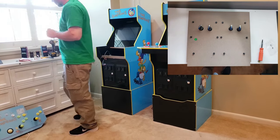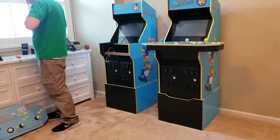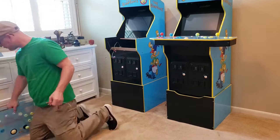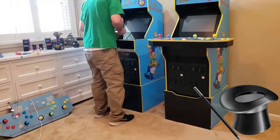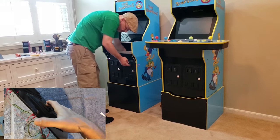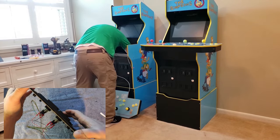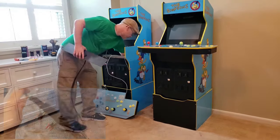When I add the screws and plastic caps back on at first, I only add two of them and I don't screw them down all the way, as I'll be needing the coin door with the button mounted behind it to have some play that will let me make adjustments. The ability to make adjustments is very helpful — without that, I'd not be able to get the coin door insert and the button mounted behind it aligned correctly. It takes a minute to get the button and the coin door insert aligned, but once the two are in the right spot, arcade modification magic happens — or rather, when we press the coin insert, the button mounted behind it also gets triggered. Once aligned and in working order, we'll finish putting all the screws in, continuing to check the working condition of the modded inserts and making adjustments as needed while fully mounting the coin door with the remaining screws and plastic mounting caps.